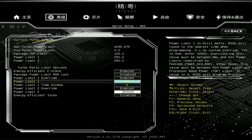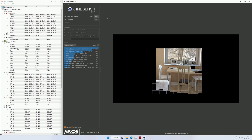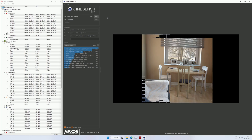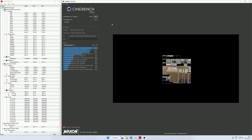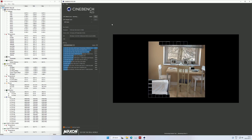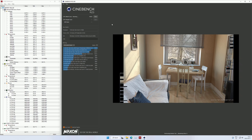Speaking about performance, the default power consumption limit for the CPU is 250 watts. I removed the limit and tested Cinebench R23 with an i7 and i5. With i7-12700K I got 22,627 points — Hardware Unboxed reported 22,840 points. With i5-13500 on the Tinue motherboard I'm getting 20,810 points and Hardware Unboxed reported 20,682 points. With i7 the score is slightly lower, with i5 slightly higher — overall the scores are basically identical. These scores indicate we have a decent VRM with this B760i motherboard.